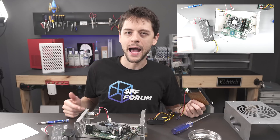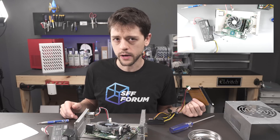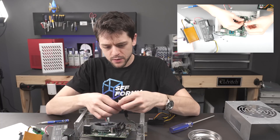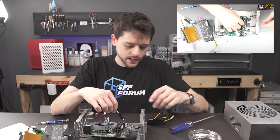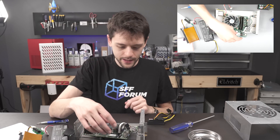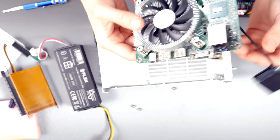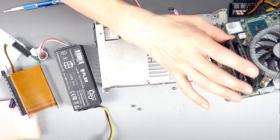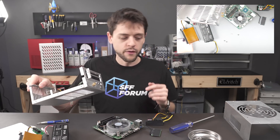Don't just expect that a 4x-to-16x riser off Amazon will power your non-powered card — it could work, but as soon as the card demands more power, it'll crash. James sourced a tiny connector, then broke out and wired up an LED and a power switch to the front panel connector. Underneath there's an M.2 Wi-Fi module. The RAM looks to be 16GB of DDR4. We're not really done tearing this build down until we take off the heatsink, which is a low-profile Silverstone affair.